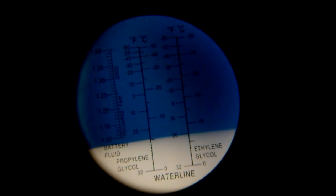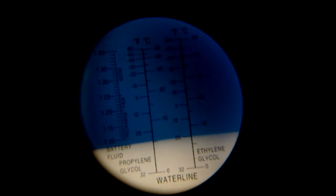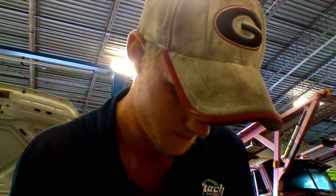As you all can see, it's at negative 20 degrees Fahrenheit — or positive 20 degrees Fahrenheit. That's a really good reading, meaning it's a good majority water. Because if it had any antifreeze, it would not be anywhere close to 40 degrees — it would be closer to negative 40. But it's mostly water.